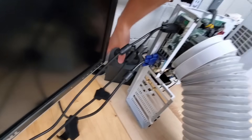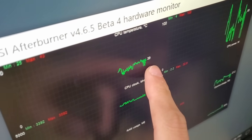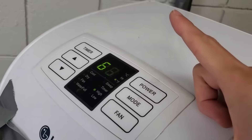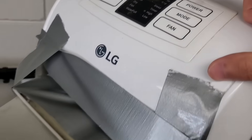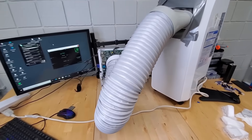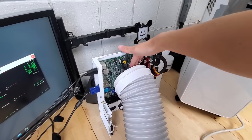With that, we can power on the computer one more time. After logging on and setting up our monitoring programs, we can again see that 37 to 39 degree base temperature. Powering on the AC unit reveals that its default temperature is 66 degrees Fahrenheit or around 19 degrees Celsius. It quickly spins to life, spewing out hot air in its back in tandem with the cold air out the nozzle. And again, anecdotally, this air feels even colder than the setup with the box fan and ice.